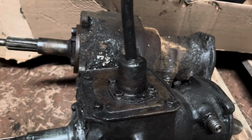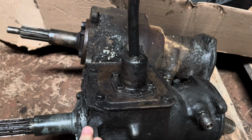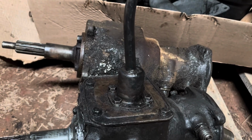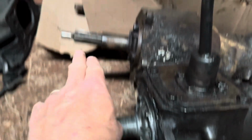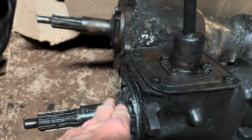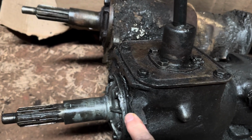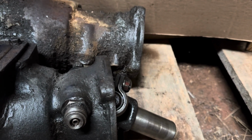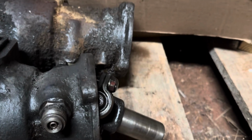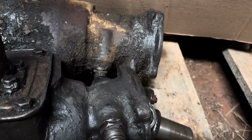I had the bright idea to convert the car to a stick shift because my column shifter is just wore slap out. Well, there's a problem. The bolt pattern does not match the bell housing. So that's not the same. But here's the biggest problem, the length. It's probably, I haven't put a rule on it, 2.5 to 3 inches shorter between here and the 48, which means the drive line will not meet up to it.